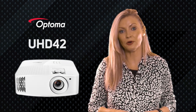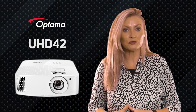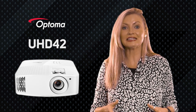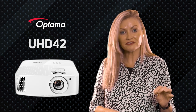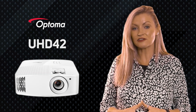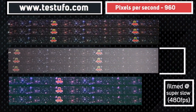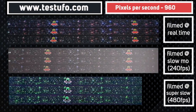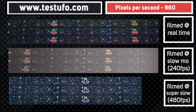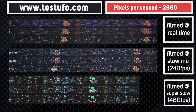Recently we've seen gaming monitors that offer 240Hz but use pixels that can't always keep up, resulting in blurring or ghosting, with techniques like backlight strobing used to help. The good news is that even without anti-blur techniques, the DLP chip Optoma favors is extremely fast — as much as a thousand times the speed of current LCD technology — so it should display all those pixels without problems. The UFO test is used to show how well a display works at given refresh rates; the spaceship should appear clear and moving smoothly across the screen.